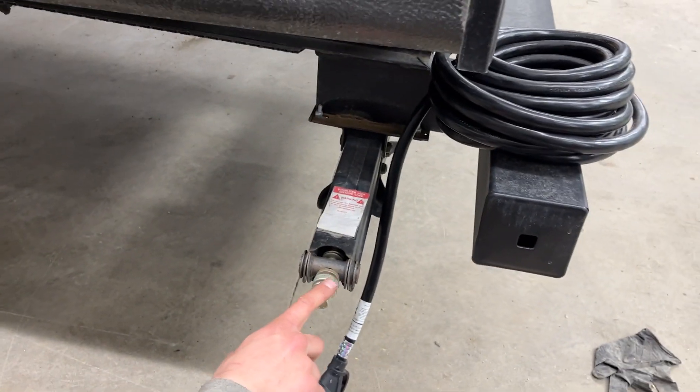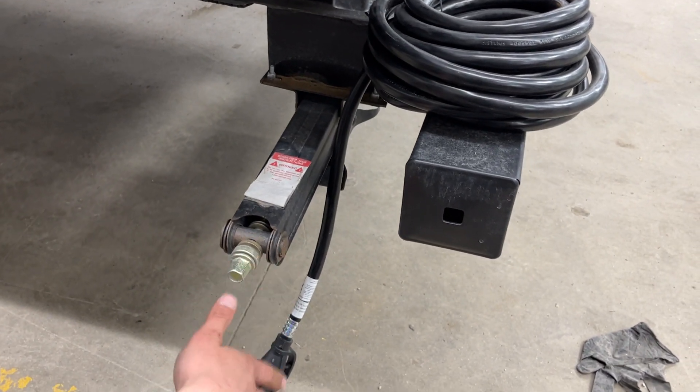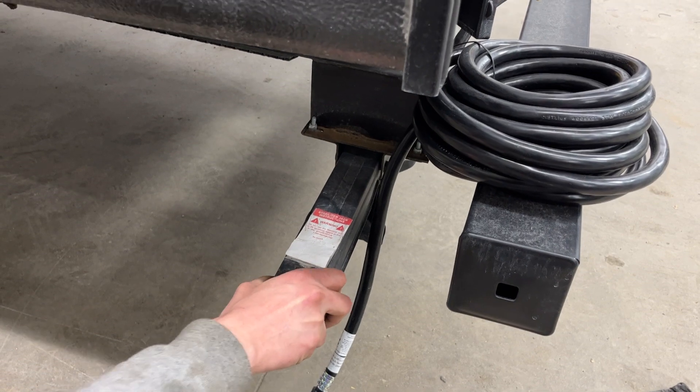The cap just presses into place. In this corner, as well as each corner of the trailer, you're going to find your stabilizer jacks. All they do is run down and contact the ground. Just give it another turn or so to firm it up, and that'll get rid of any sort of bounce or sway you see in the unit right now — just keeps things firm while you're out camping.